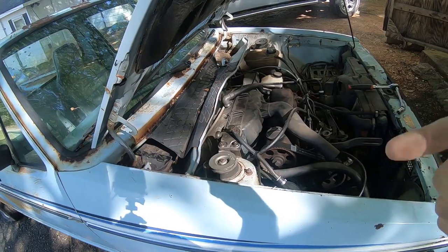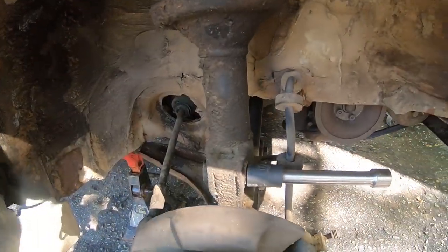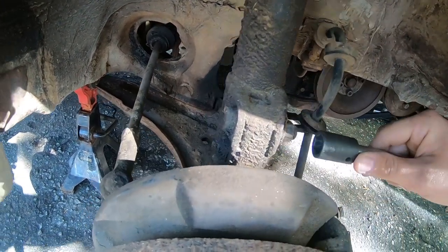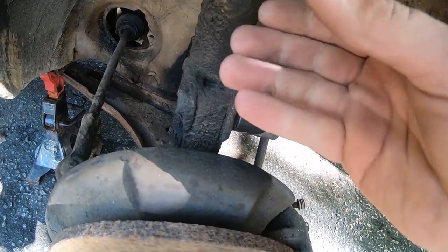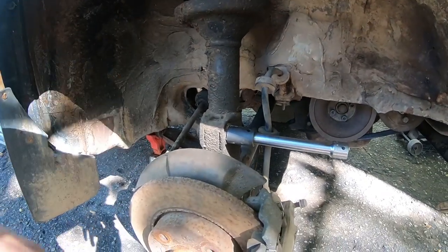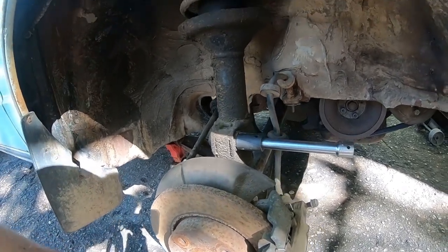All right, so to begin with, let's get the old coilover out. You've got 2 13 millimeter nuts and washers on the top hat here. And then you go underneath, and you've got a 17 millimeter bolt with a nut on it. Now, if you were just putting a factory strut on it, these have adjustments. It's got a washer with a little bit of an egg on it so you can adjust your camber in and out. But with putting new coilovers, we're pretty much gonna have to put them on there, see how they look, and then in the near future, when we can, we're gonna get it aligned.